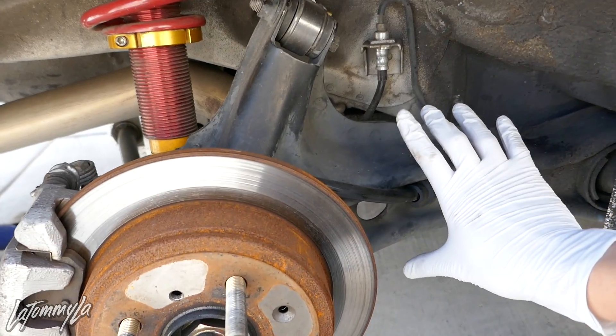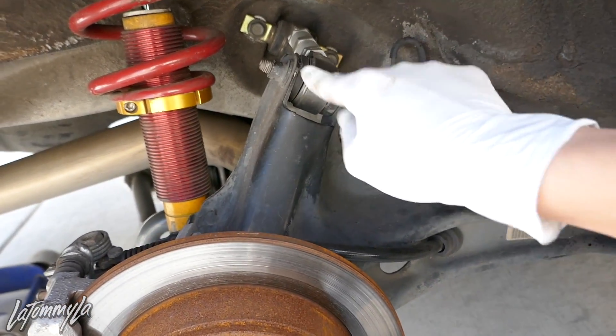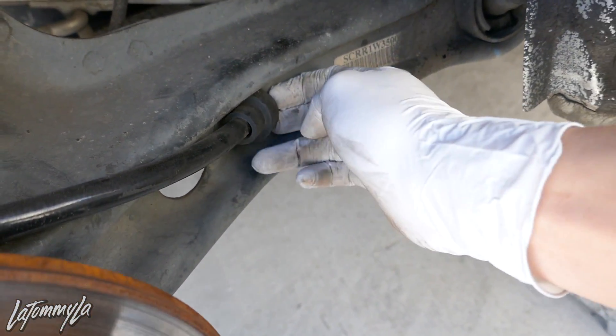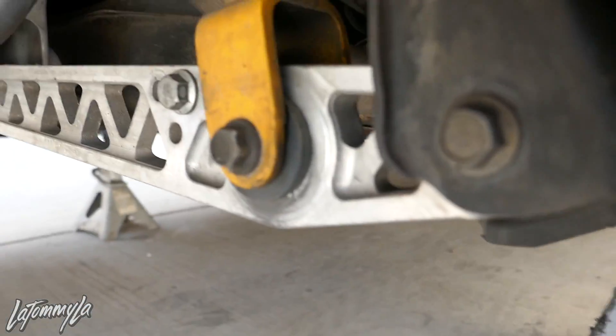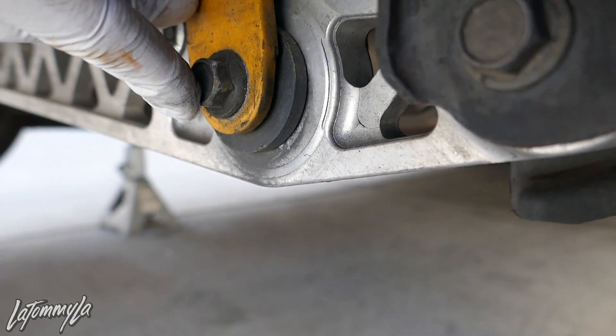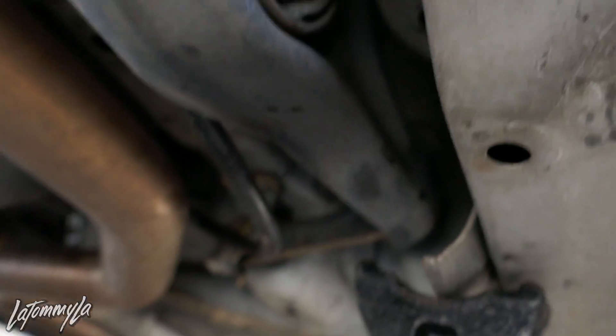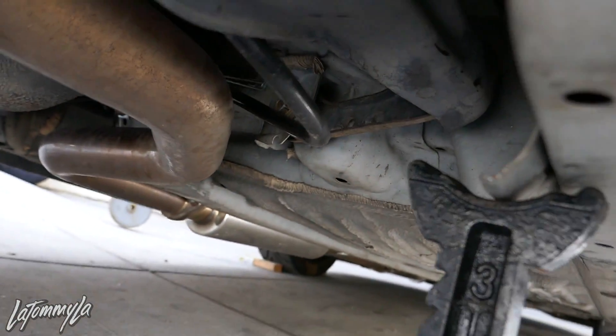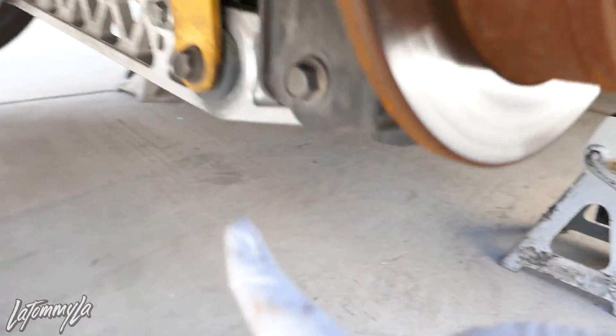It's really simple — just look at what bolts you need to remove. For the trailing arm you take off the two frame bolts, the three caliper bolts, the red e-brake cable, the LCA bolt, two more bolts under here for the trailing arm bushing, and the toe arm bolt. Mark the toe bolt position before removal so your car isn't all out of alignment when you drive to the alignment shop. Taking off the toe bolt will affect your alignment, so get an alignment right after.